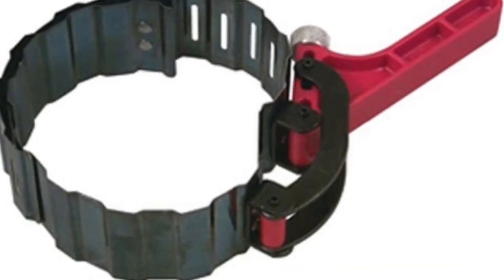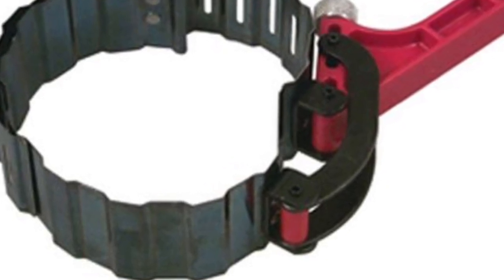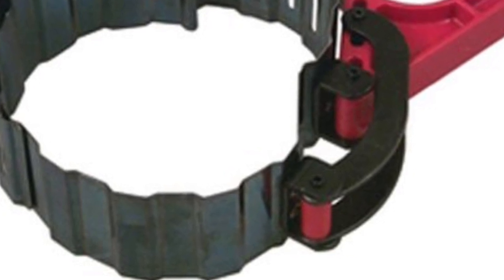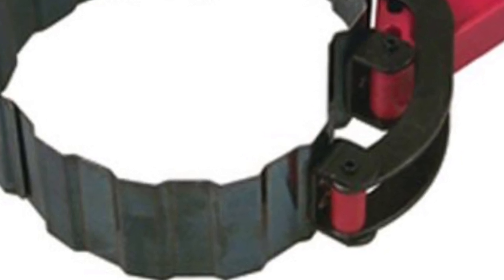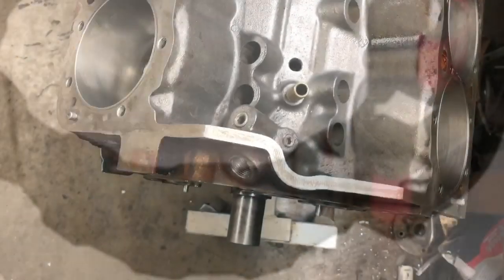This crinkle design is probably one of my favorites as well. It doesn't have a lot of contact on the side of the piston, so there's not a lot of friction — the ring and the piston really compress easily and it slides right down into the bore effortlessly. The problem is you cannot have o-rings sticking out of the block; the block has to be flat. But for the most part it went together pretty good.